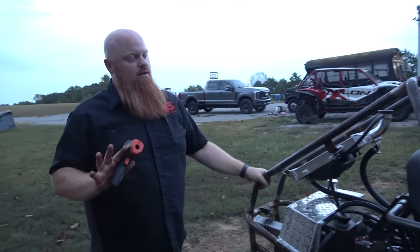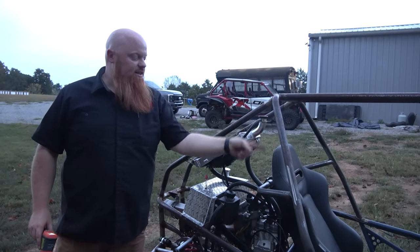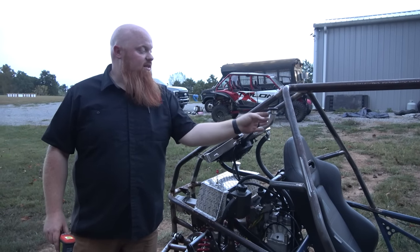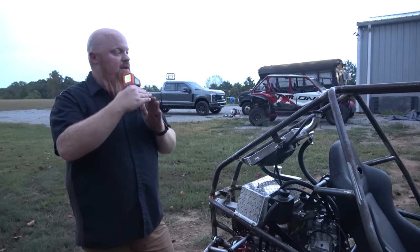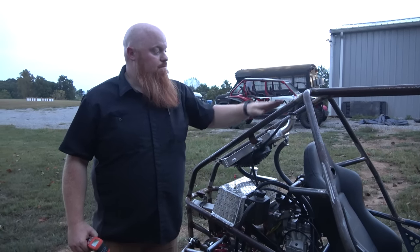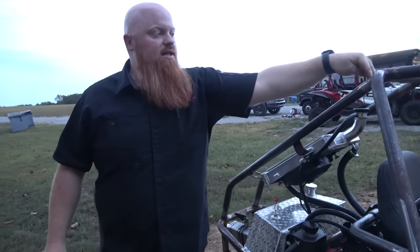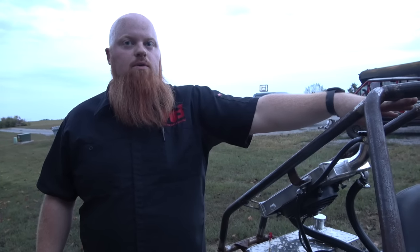So this is my plan for the radiator to shield me. I'm gonna come off this bar straight to this one with an upright support, and then because I'm adding this now, I'm gonna take a piece of 1/8 inch aluminum and bend it so it bolts to this tube and then bends with this one and then lips up. One of my buddies, Chris Schmidt, had this idea to make it lip up. Don't just end it right there. Then if coolant was to blow, it would blow over that crack.